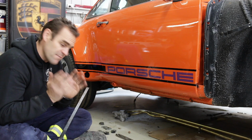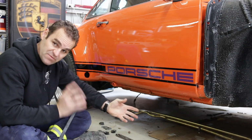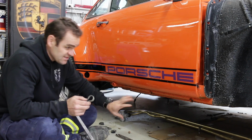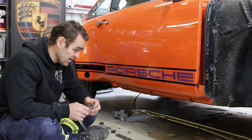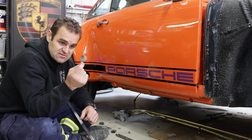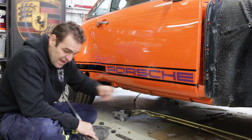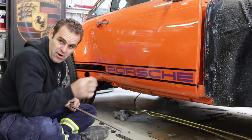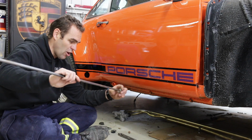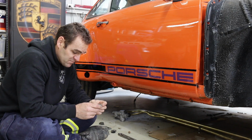Okay, I've been looking at how I'm going to attach these oil lines to the car. I have these mounting points that were there. The add-on air conditioning that my car had originally ran along the sides, and this obviously had seal covers on it for its year, which I'm no longer running. It used these rubber-coated hose clips. The original oil cooler clamps are actually a pressed piece of metal. I'm going to make up something similar out of this piece of rod. This will sit over the top, bolted on in the same spot to clamp them where they want to be. So that's my theory.